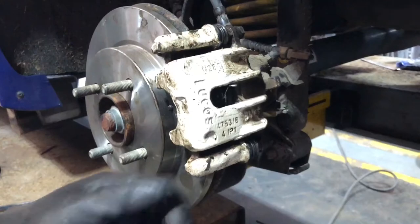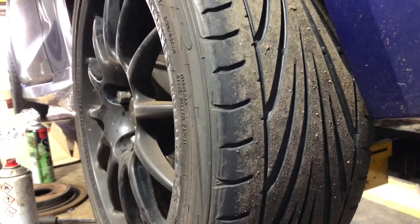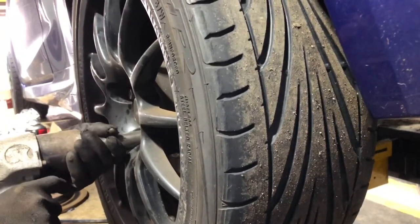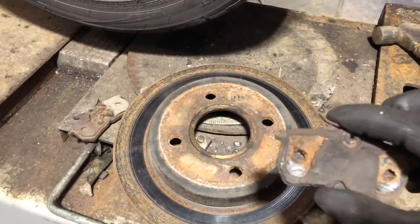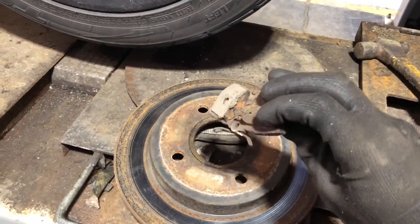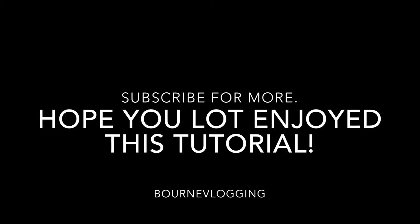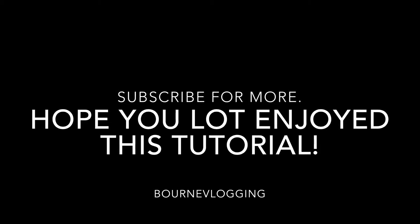Once that's done, that's pretty much it — well done if you've got this far. Go ahead and bolt your wheel back on. Once you're in the car and started up, pump your brakes straight away before you release the handbrake. Hopefully this tutorial has helped — it applies to a Fiesta ST and possibly a normal Fiesta too. I used Brembo pads and discs if anyone wants to know. Thanks for watching, hope it's been helpful. There's another video coming soon so subscribe, like, and comment, and check out everything in the description below.